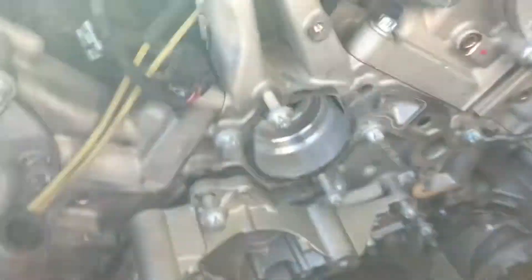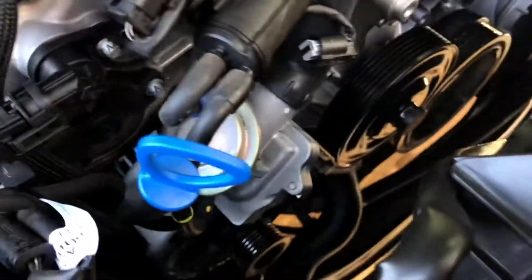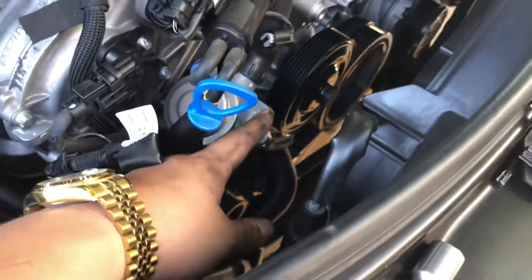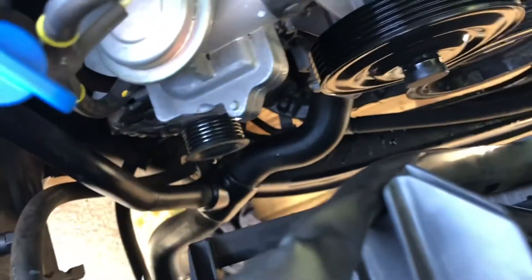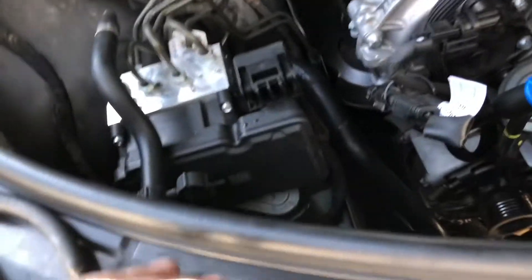It's been a mission but we're making progress. I already connected the lower radiator hose towards the water pump and slid it down. I just need to connect this tube and the lower tube to the radiator. After that I'll get the top on, then connect the upper radiator hose to the thermostat. It's a slow process but enjoy it.